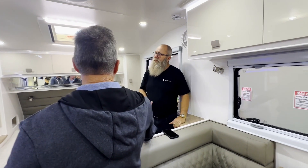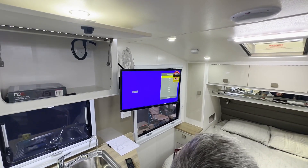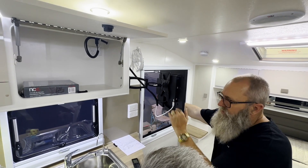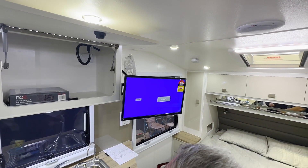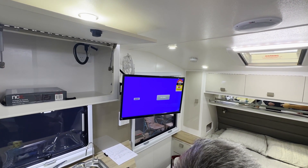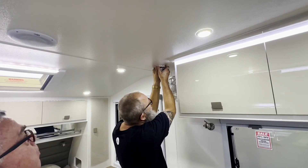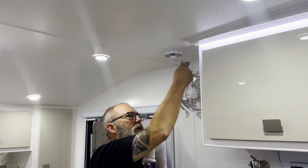Different inputs available include digital television, DVD, HDMI, and USB — all connected at the back. When travelling, everything needs to be stowed. Pull the antenna arm down, rotate it around, line it up with its mate on the roof, make sure it's locked in, then wind it back down — just until it feels firm, don't over-tighten. Then turn the TV off. Make sure you unplug it from the socket first because it's got a 6-amp glass fuse in it — if you pull it out while live, it will arc and blow that fuse. Good luck finding one in the middle of nowhere.